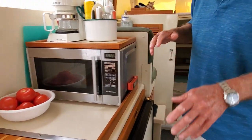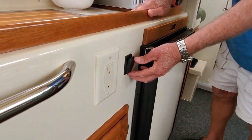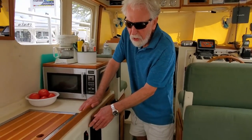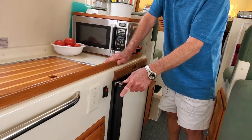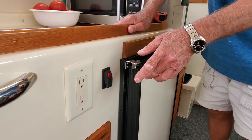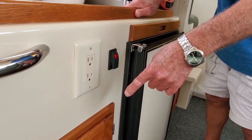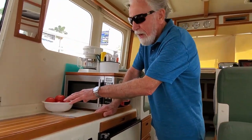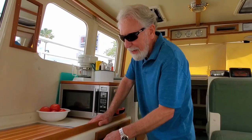In the galley area, we added a propane sniffer and solenoid shut-off for the propane tank. If you want to use the propane stove, you turn on the propane, which opens the solenoid and turns on the propane sensor — so if you have a leak, it detects it and sounds an alarm. I put the sniffer inside the cabinet because that's where the hoses and connections for the propane are, so it seemed like the first place a propane leak would occur. A red light on here tells you the propane is on so you know to shut it off when you're done.